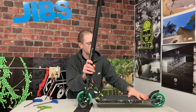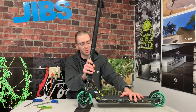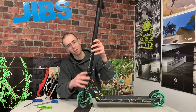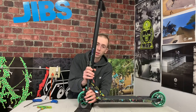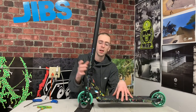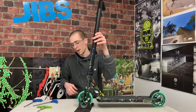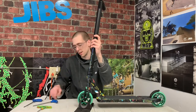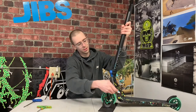This scooter is almost ready to ride but there's one more adjustment — it is the most important adjustment — and that would be your compression. This one gets a lot of people because it's sometimes a little bit of a mystery what all these parts do. The beauty of the compression adjustment though is that it really is just one bolt. The first thing you need to do is get access to that bolt, which is simple — you just pull off the handlebars. To do that you need to loosen your clamp bolts. Same as the axles, most of them are going to be five or six millimeter allen keys — just put your allen key in the clamp and loosen those bolts.